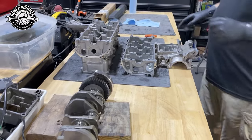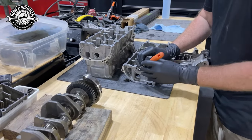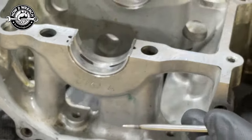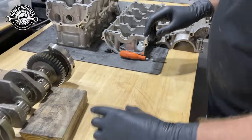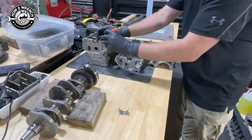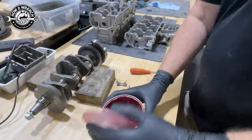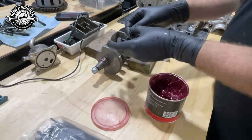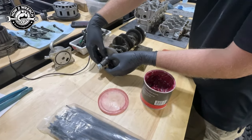All right. Now that I have gloves on — here's what I'm going to do. There's no top or bottom; this doesn't matter. We have a couple different little relief tabs — that's a locating pin, so that when you put the crank halves on, that's what holds it so it doesn't spin in the engine case. So I'm just going to put a little bit of pressure right here and set that off to the side. I'm going to grab my matching one, set it like that, and then I'm just going to grab some grease around here. So that's my number one main.